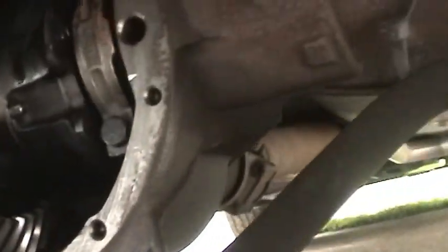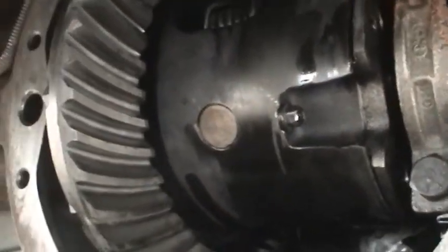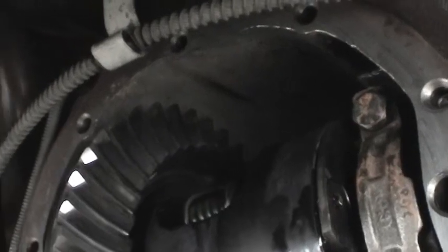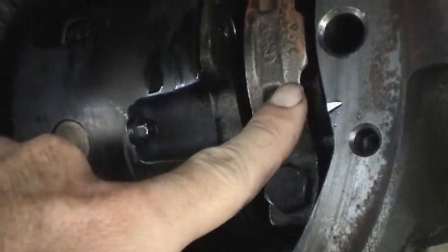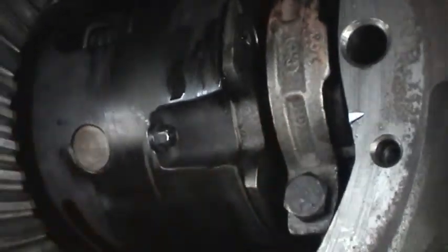Spent about 2 hours cleaning everything up, but because of the age of the car and the fact that this gear oil has never been changed, I went ahead and dumped a couple of cans of brake cleaner in here and cleaned everything up to the point where everything pretty much is like new. You can even see the bare cast iron housing. There's just very, very little sludge, especially on that bearing cap, which I scraped off earlier in the video. It's clean as a whistle.